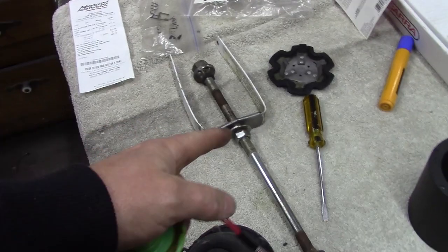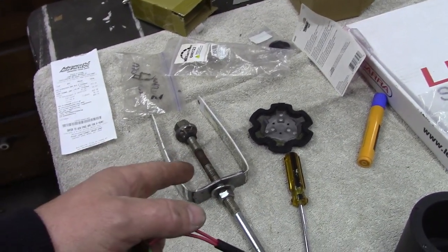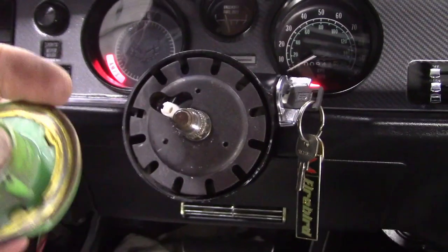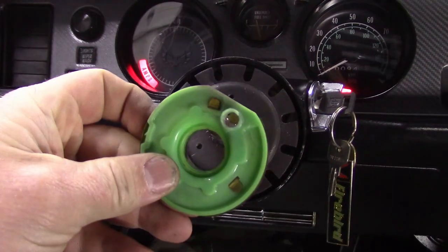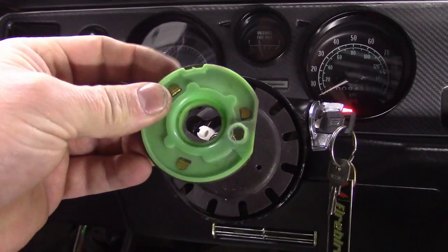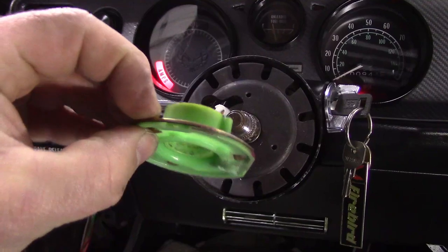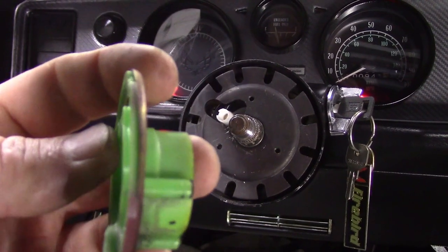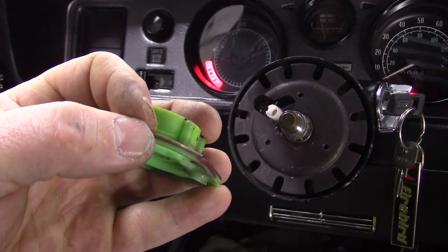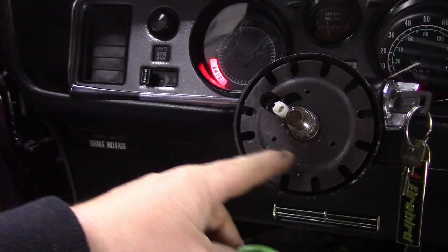This tool works awesome. I had to take this horn apart and put it back together like five times because I kept getting a constant hot at my horn harness. What was happening was that Dorman part — when you pushed the plate down it was grounding it out. You see this copper ring? It rides on your constant 12-volt pin inside. When it was being pushed down, it was pushing the plate into the lip on the new piece and grounding it out. I finally figured it out and put it on the grinder and ground this edge off so it's not curled up and over — recessed it back a little from the plastic so it has no way of touching.